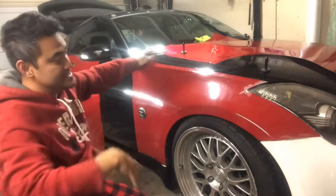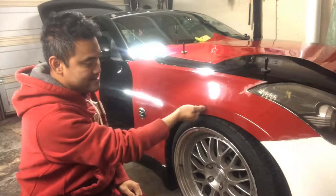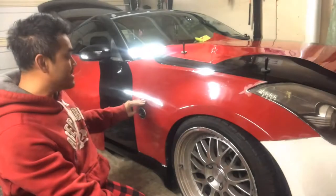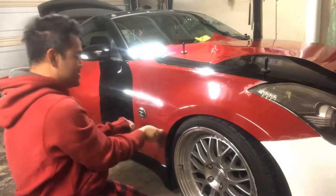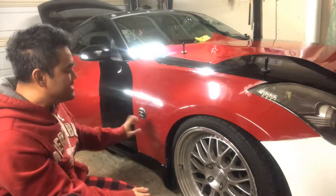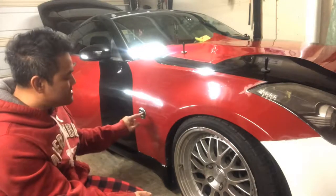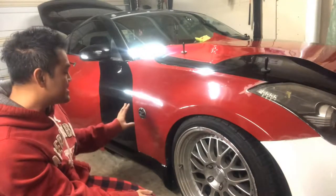If you're by yourself you'll probably end up getting wrinkles, but having wrinkles going horizontally on this panel is ideal at first. You grab up here, pull that way, then grab down here, pop it out a little bit, and pull it down. Once you get to about this point you can work it with your palm, pull it down past the emblem, then heat it up and wrap it over the emblem and cut it out.